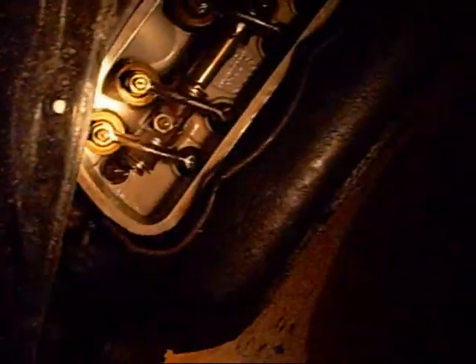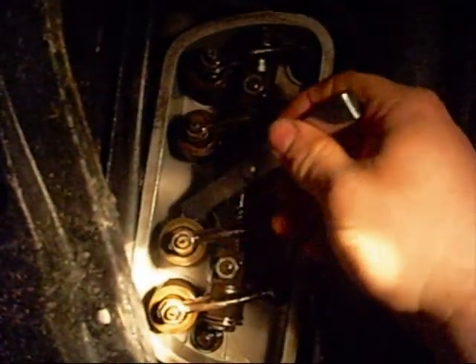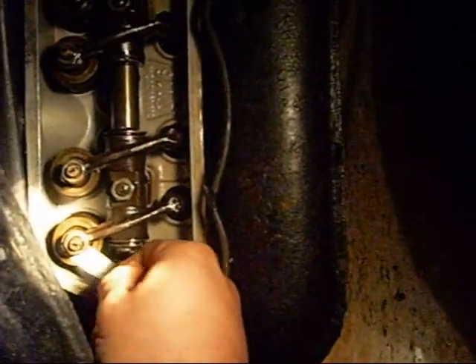You come down here and to make sure — if you wiggle the valves they should be loose. Whereas this one you only have one tight one. These two are loose, so these are the next two that you do. So you grab your feeler gauge and you check this one. Get it up in there. It's a skosh tight. But since it's at six thousandths, if you take your four or five thousandths one out since we're shooting for six — hang on one second.